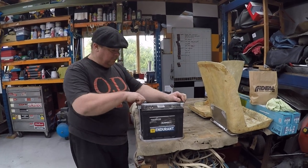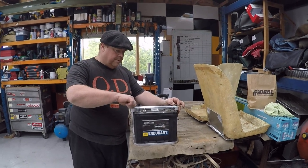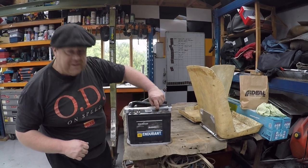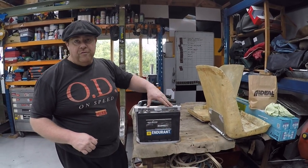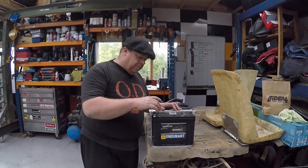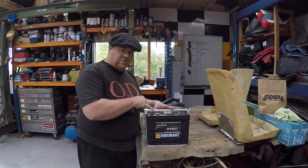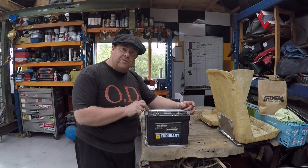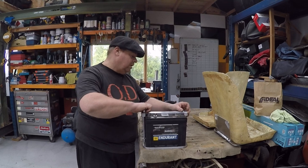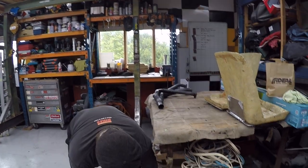With the top clamp going on, once this is torqued down, there is a piece of rubber under here so I don't over crush onto the battery, and the battery has got a little bit of expansion. If in an accident somehow this connects to here, that's why I'm putting in the plastic piece screwed to this bar so it won't spark out. Okay, so that is the battery. As you can see, it's not light.